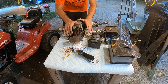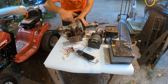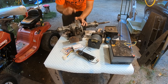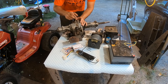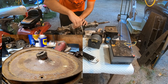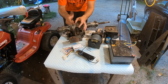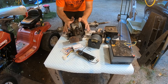So here we are — this is our F&R, this is the core of the idea. Basically if I spin this, it's a direct connection straight to the axles, and it has a brake built in for mechanical braking. The nice thing about an F&R is your mechanical braking is always active even if the transmission is in neutral, so at no time do you lose the ability to stop the unit. It uses a special spline that goes in with a pulley, and you can pull it off, punch that spline piece out, and weld it onto other stuff. In the past I've made couplers and drive shafts, and I actually built a gas-powered power wheel that uses one of these in the rear — you can check that out in the description.